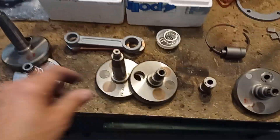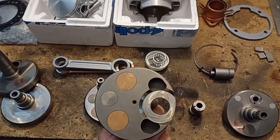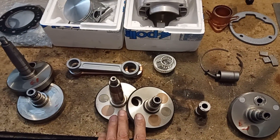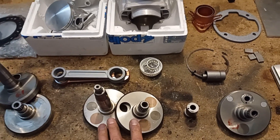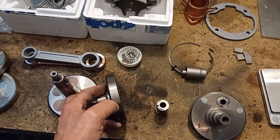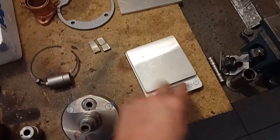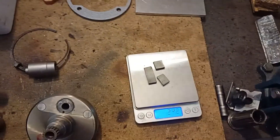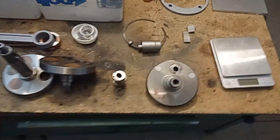Otherwise I would have to rework it. I had a 60mm web from BGM — because of the holes on the top and the different counterweights, the factor is already at 30%, which is not too bad. What I then considered, by measuring the rebalancing, is to put some extra weight on the outside of the webs by welding something on. These additional 32.5 grams will bring the balance factor to the range I mentioned.